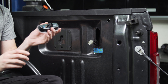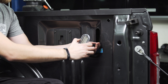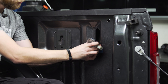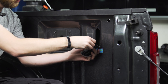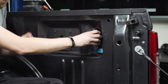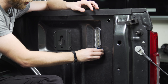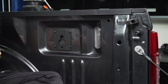Now with the new Morimoto light it's going to go in the exact same way we just popped it out, so we're going to reconnect our wiring and everything here. The only thing you want to make sure of is that you get that right tab on the bottom and you don't position it upside down. There we go — click it in just like that. You can peel the tape off here as well.